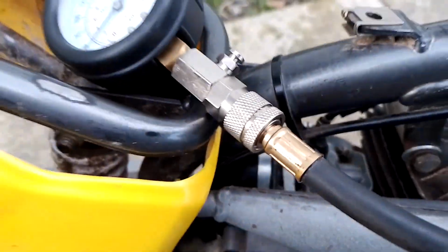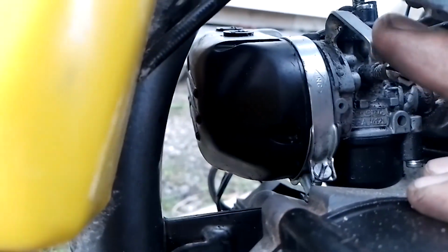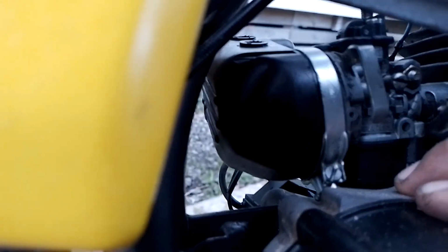Air-cooled fins on it. Carburetor down inside here. And I don't know how many people know this, but you see my finger there, if I can focus on it. There you go, see my finger up top there. That's the choke. Push it down. Choke's on. And if I give a full throttle flick, you keep watching that, it turns off. Just in case no one knew that.